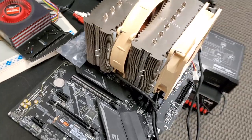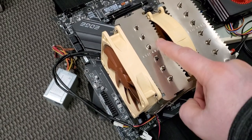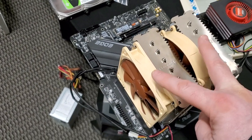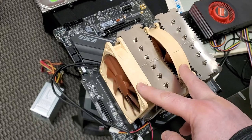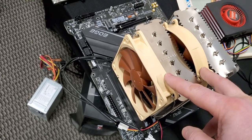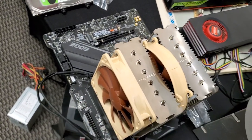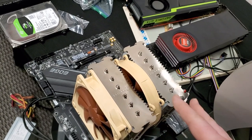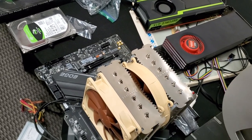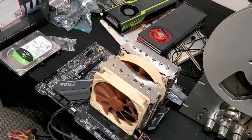Let me show you a good system. In my opinion, this is the best system — this is also liquid cooled, because inside these pipes is liquid that gets pumped through. If this thing fails, number one, you see right away that the fans aren't turning. A big problem with these systems is sometimes people put the fan in incorrectly and they blow into each other, so be careful — make sure the fans are blowing one way. If you think it's overheating, you can touch the actual pipes and feel the heat. This system is a lot easier to troubleshoot than a liquid-cooled cold plate system.